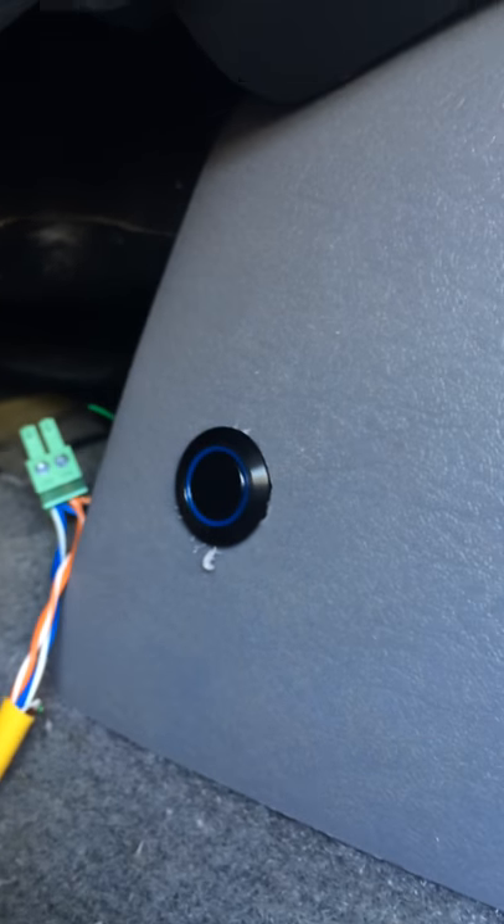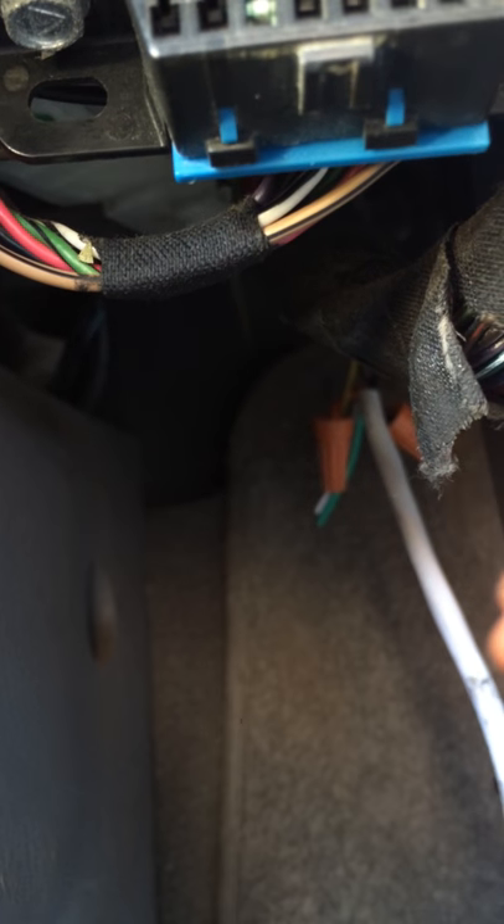I bought this button — it was $10 off Amazon Prime, shipped for free. I wired this button, had some clearance back here, had to solder a little bit and hook it up. Now basically the 12 volts goes to the switch, and that switch comes back to where I poked in with the clutch bypass. That basically sends the 12 volts right to that starter relay.